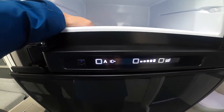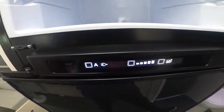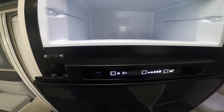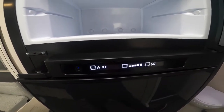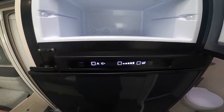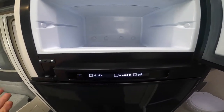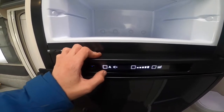At the moment we've got a gas bottle on the back and it's hooked up — it knows not to waste gas so it's gone to mains power. If I were to take the hookup off it would switch over to gas, and if I started the vehicle it would go to 12-volt. You need to pre-chill beforehand on either gas or electric first, then put your shopping in the night before or when moving between sites so it stays fresh on 12-volt as you travel.